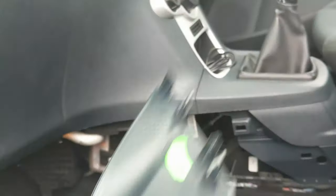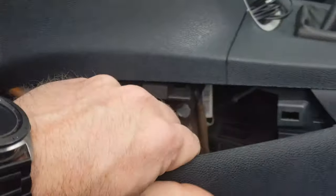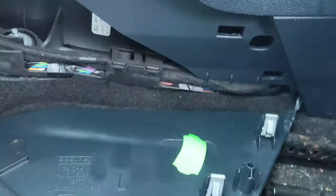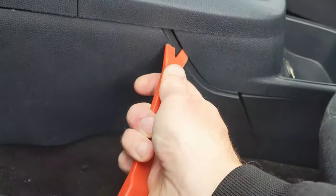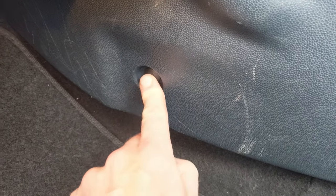You need to put the trim back on. This faces forward and you'll see the lugs there: 1, 2, 3, 4, 5. Line these up and what you'll notice is this trim is now under where it should be. Use the trim removal tool, stick it in the slot and a wee pop down like so. That's it in. We just need to put in our little plastic screw here - line up with the hole, push the base in first and then the screw will just push in.